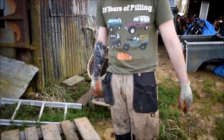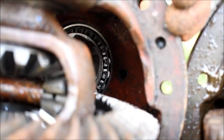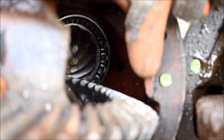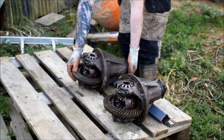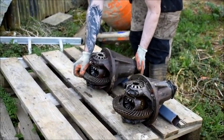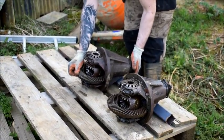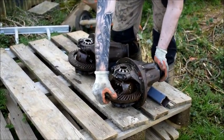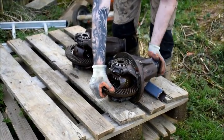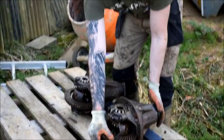I'll show you the working diff and the knackered diff and the bearings. Here is the working diff — as you can see, no play, not much play there, nice shiny bearings inside. And the bad one? Lots of play, lots of knocking, and if you turn it, it starts to lose drive. If I hold this — there we go — losing drive. So this is the working diff: if I hold that and wobble this, it moves, not too much banging, not too much play, the bearings are doing their job. And then on the bad one, I can literally turn that around because the bearings are pretty disintegrated, meaning I've lost my drive to my front axle.